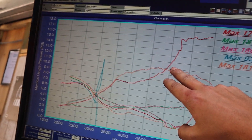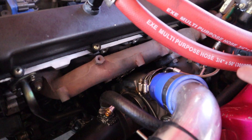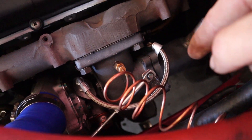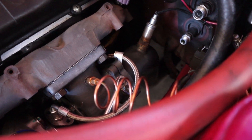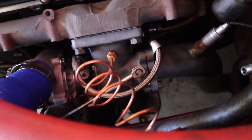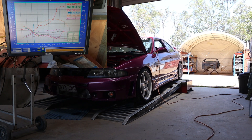That steady boost increase up to about 11 PSI would be great. As you know, in the compressor housing we're going to see an increase in pressure faster than the rest of the intake system — that's how they're designed to work. So this reference off the housing is seeing that pressure earlier. What's happening is there's not enough preload on the actuator rod to hold the gate flap shut — as soon as the turbo's spooling up and showing pressure, it's allowing the gate to creep open. Since we've done a really decent port job, we're losing a lot of gas through there. So I'm going to shorten the actuator arm to add some preload on the wastegate flap.